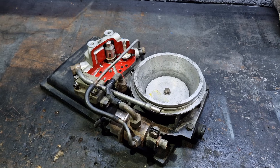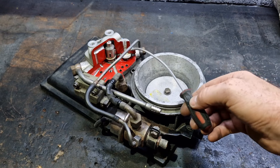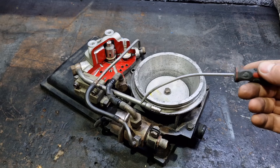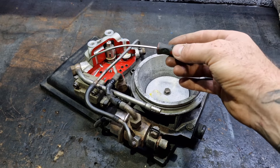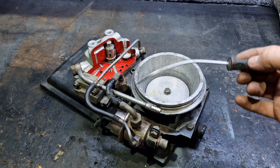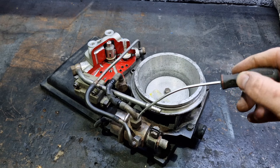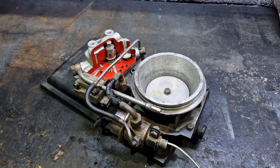The main physical difference is these KE units are aluminium and the other ones are cast iron. On KE-Jetronic units, the control spring sits in the lower chamber, whereas on K-Jetronic it sits in the top. We also have this big lump here — an external fuel pressure regulator. Fuel comes in, fills up the upper chamber, and inside there's a valve and spring which is adjustable, as I've shown in other videos.